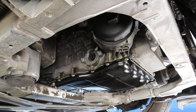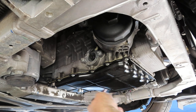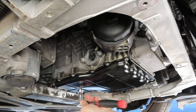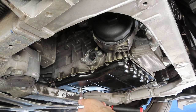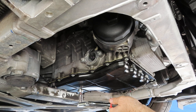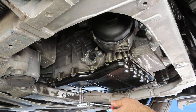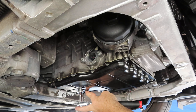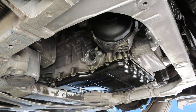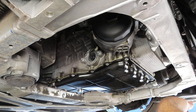This car holds about 9 quarts, so that drain pan is heavy and full. You do not want to damage this pan — it's not very thick, so there aren't a lot of threads holding it. As I'm turning it I can feel it starting to compress the gasket, getting tight, and you can actually see the pan flexing as you tighten it. That's where I stop.